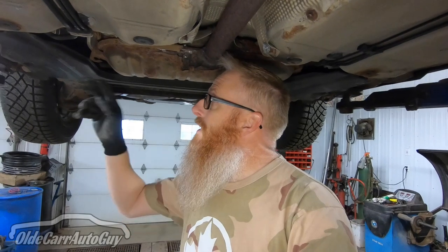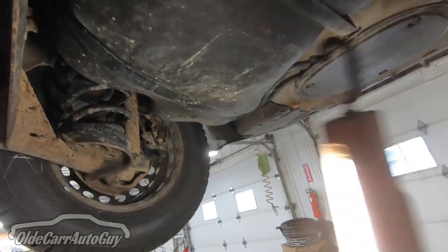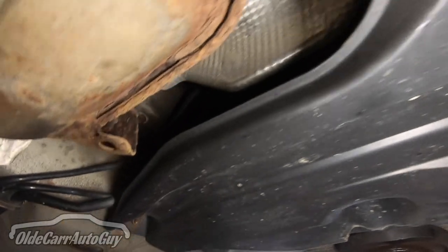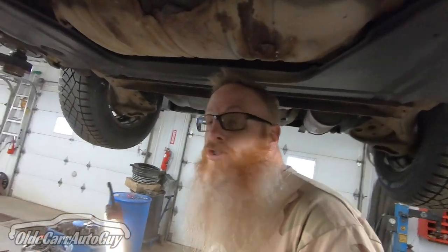One of the things we're going to be working on today is replacing the fuel filter. I don't know when it was last done. We do have a little bit of hitching once it gets up into the higher RPM range. We've already done the spark plugs and coils are on the way. If you can't find your fuel filter, all you've got to do is find your fuel tank — that big black plastic thing — follow the lines that come out of it all the way up the length of the car until they reach the engine. In behind the plastic piece up there is where the fuel filter is.